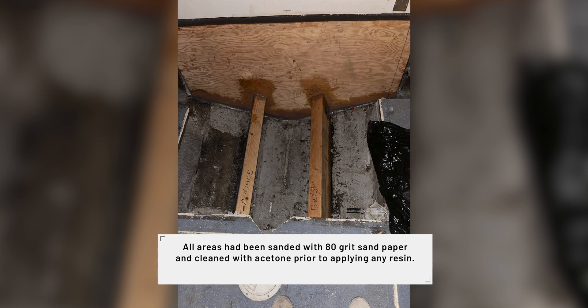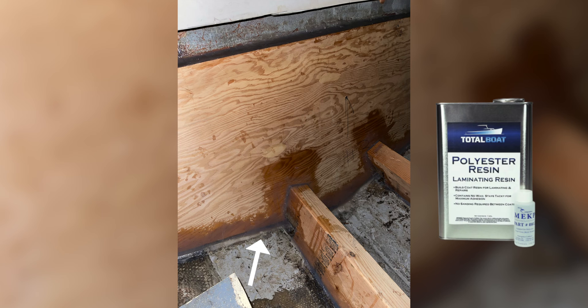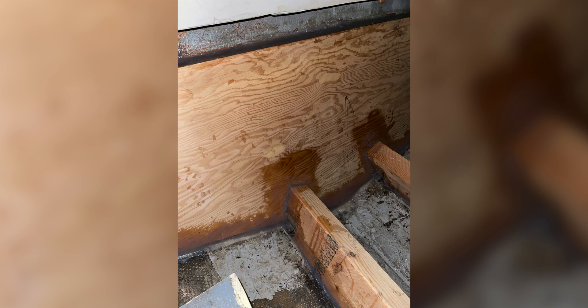The next step was putting our third piece of marine ply and our stringers into place after the previous pieces had dried. We made another peanut butter, but this time out of polyester resin along with fume silica, and also used a polyester structural putty to fill all the gaps, sandwich down the stringer into place, and set that third piece of marine ply. We also filled the large gap in the top of the wood with some polyester structural compound.